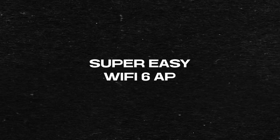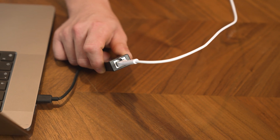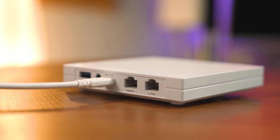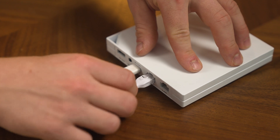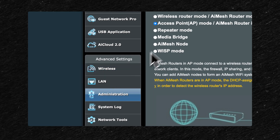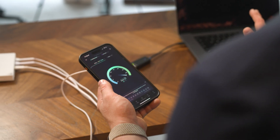Scenario number two. Let's say I'm at my desk — whether at work, at home, or in a hotel room — and I have a LAN connection available that I'm using on my device, in this case a MacBook Pro. However, I'd love some Wi-Fi in here for my portable devices like my phone. This thing has Wi-Fi 6 built in, so it's basically a Wi-Fi 6 access point powered via USB. We're going to disconnect the internet connection from my PC, plug it into the WAN side of the travel router, take a patch cord into the LAN side and then into my laptop. Going to administration, you can see I'm in access point mode, or AP mode — yet again, another use case for these small travel routers. And I'm not even traveling.